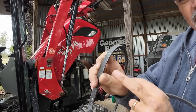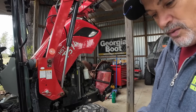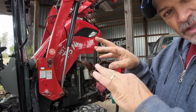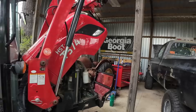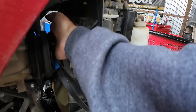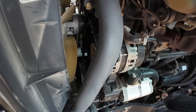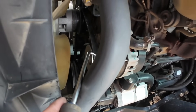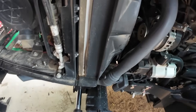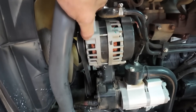You can see where I tried to spray some belt conditioner on it - that stuff don't work. It just makes the squeal go away for a little bit. You gotta wrap this over the fan and then weave it back onto there. If you've got big hands, it might be a little challenging, but you can get it. For this pulley, I had to get a heavy duty pick and kind of slide it down in there. But other than that, it's okay. Now I'll just adjust the tension on the alternator here, check that, and be good to go.